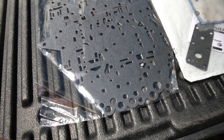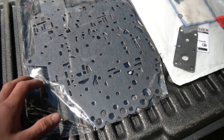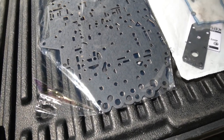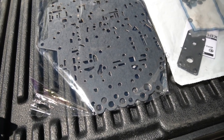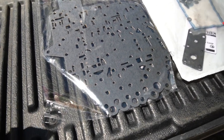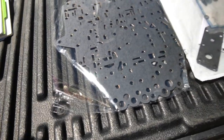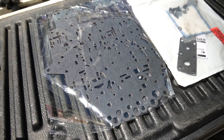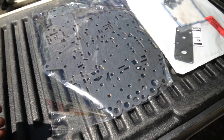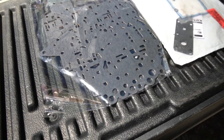The main purpose of doing this kit is to get this bonded separator plate installed. To keep it somewhat brief, what this basically does is change the fluid circuitry in the valve body, and it allows you to up the line pressure of the transmission, therefore allowing you to get stronger clamping force on the clutch packs, helping to generate a little bit less heat from having less slippage. If you don't know the drill, I will have NextGen Diesel's YouTube channel linked up below in the video description so you can go check out Nate talking about this kit and giving you the full rundown.